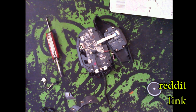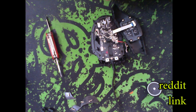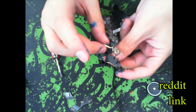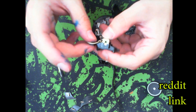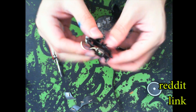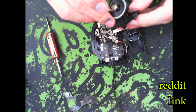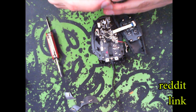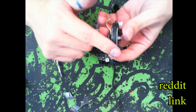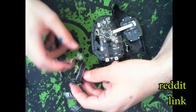Time to rebuild. The way this goes: the little pointy end of the square sits at the bottom of this part, and the cables stick out on the end. There is no snapping — it does wobble a little bit, and that's normal, that's how it comes. Put it back onto the mouse wheel, then put the mouse wheel back into its assembly, making sure it seats properly. Right from here you can already feel how much harder it is to spin the wheel — however, it works.